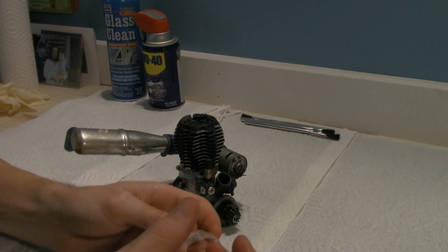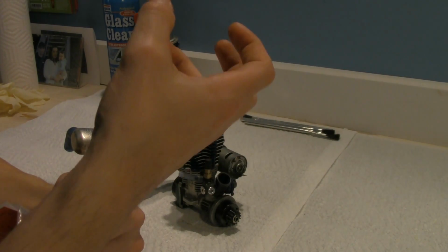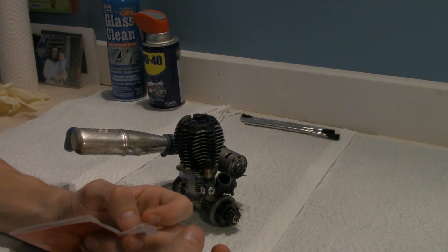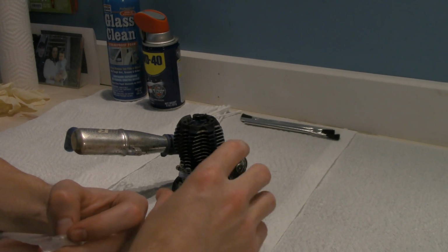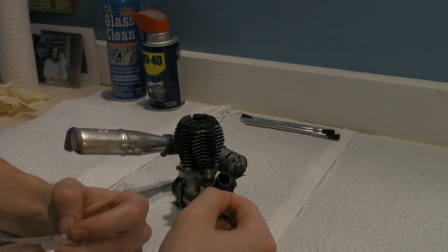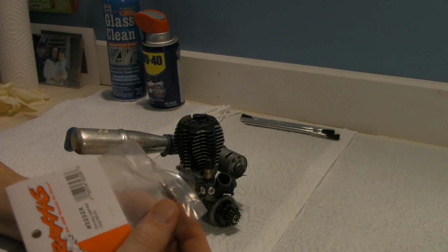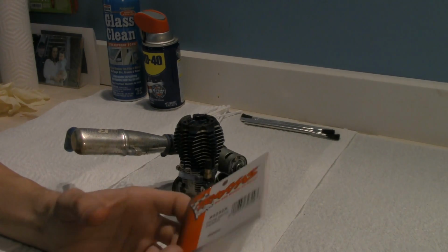When it glows, it gets hot. As that piston comes up, it creates combustion from the pressure and the heat inside. And that's what shoots the piston down. But because there is so much heat and power and how quickly that piston moves up and down, you don't need a wire on this glow plug. It will always stay hot, so it always keeps it running.